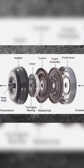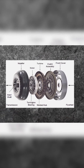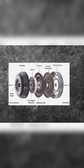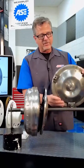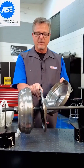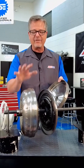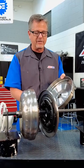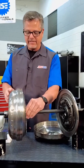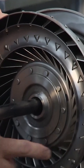What's going on inside the torque converter? You can see it right here. It all starts at the front cover, goes through a clutch, a turbine, a stator, and an impeller. Here's the actual cover that's bolted to the flywheel — this is spinning. This is a lockup converter, so it will actually lock up and give you direct drive one-to-one after it's done multiplying torque and you just need speed. The first piece here is the turbine — look inside and you have these fins.